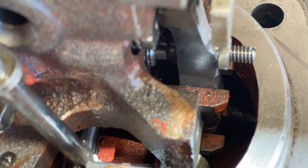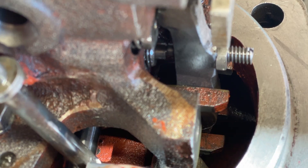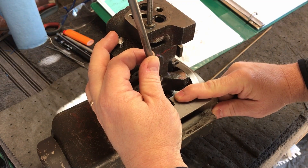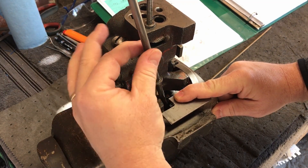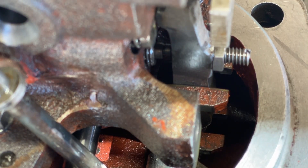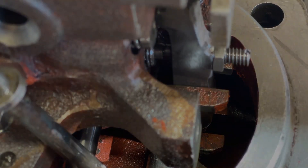I'm approximating one turn here. I pushed the top of the tool down to where it's supposed to be and you can see that it pushed in that TCU valve just a bit. I'm kind of happy with this — I'm not going to take it out and redo anything, but it's just touching and then I push it down to where the tool is supposed to be on the edge of the housing, and you see it pushes it in just a little bit. I'm thinking that would be about one turn, so I'm happy with that.